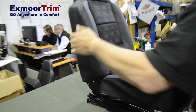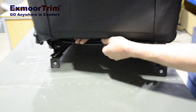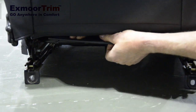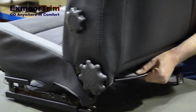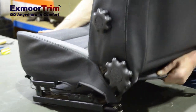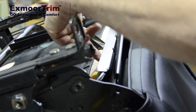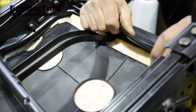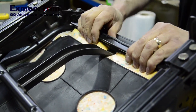We need to do the back one first, so tilt it back up — a little bit awkward, turn it sideways. You need to be able to get to the back J-moulding here. Grab the J-moulding that's poking through the back in the centre — not the edges because you'll start ripping it. In the centre, tap the front of the seat so it comes back. Now tilt the whole seat over. This J-moulding has to go back onto this edge here — it's quite hard to do and needs a good pull. Don't pull it on the edge; keep pulling it in the middle until you've got enough to go around, then start feeding it from one edge. That's the J-moulding in place.